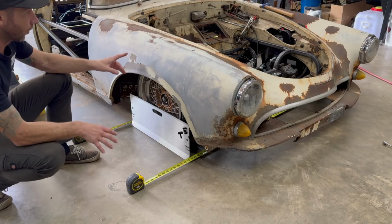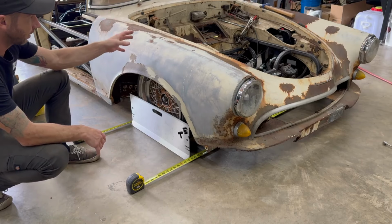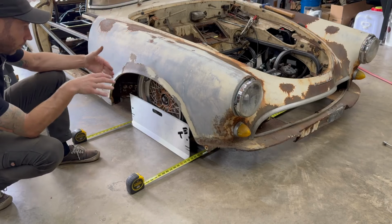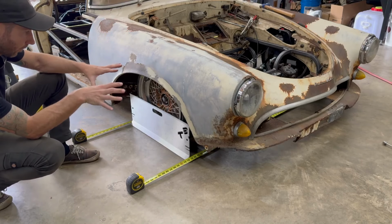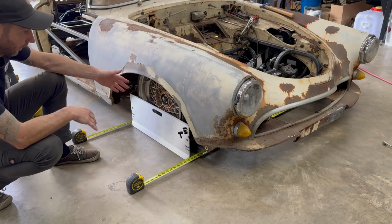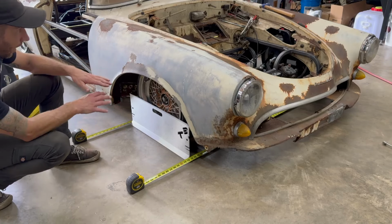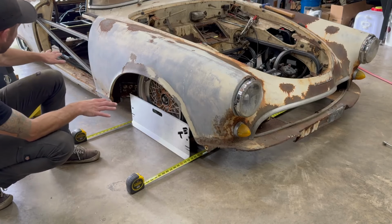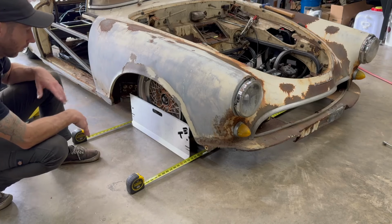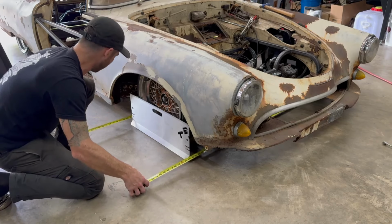All right, so before I go any farther in building the steering column, I really want to have an idea at ride height, what it's like zeroed or 1/16 of an inch in, whatever the book might call for on a Beetle front end, for toe in or toe out while you're driving. I put some air in the bags, brought it up a little bit, just eyeballing where I think I might drive it at, super low. So now I'm getting a tentative measurement.